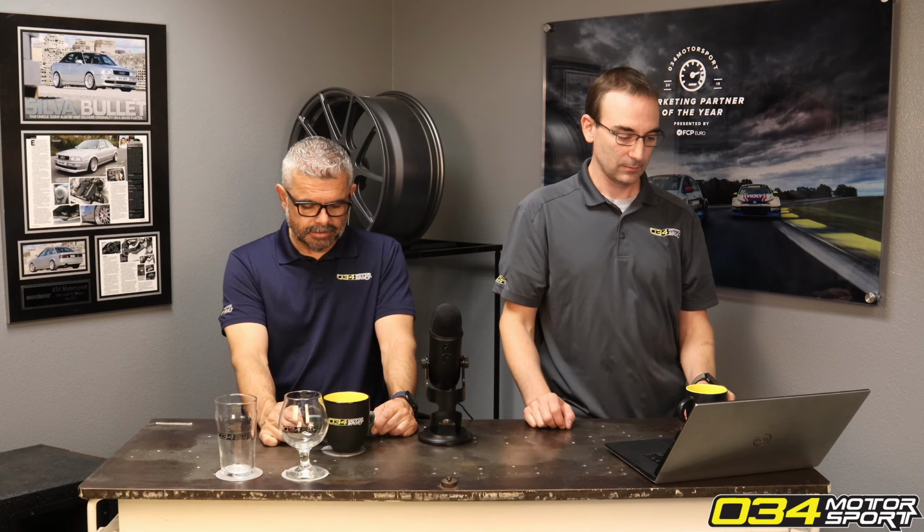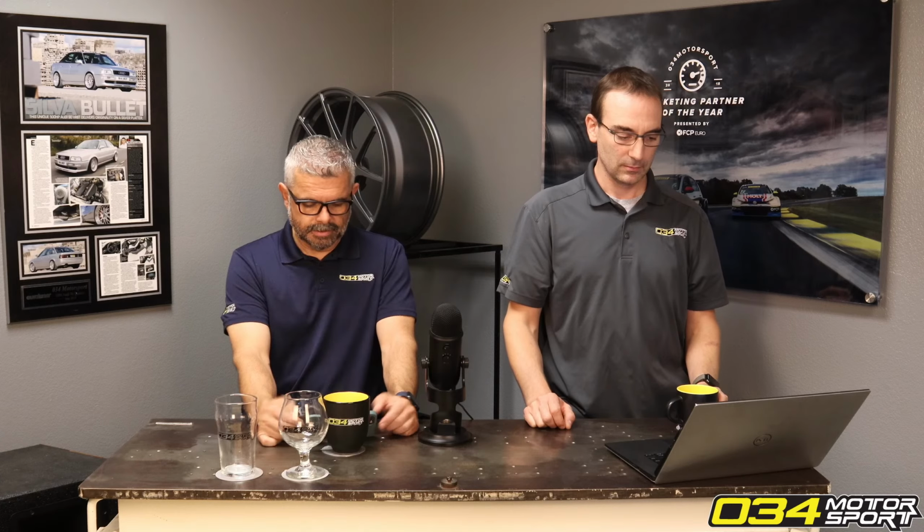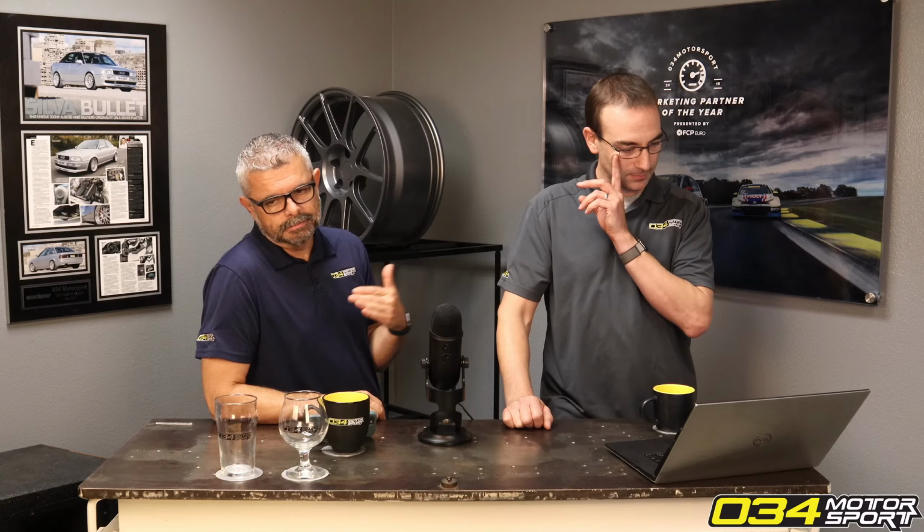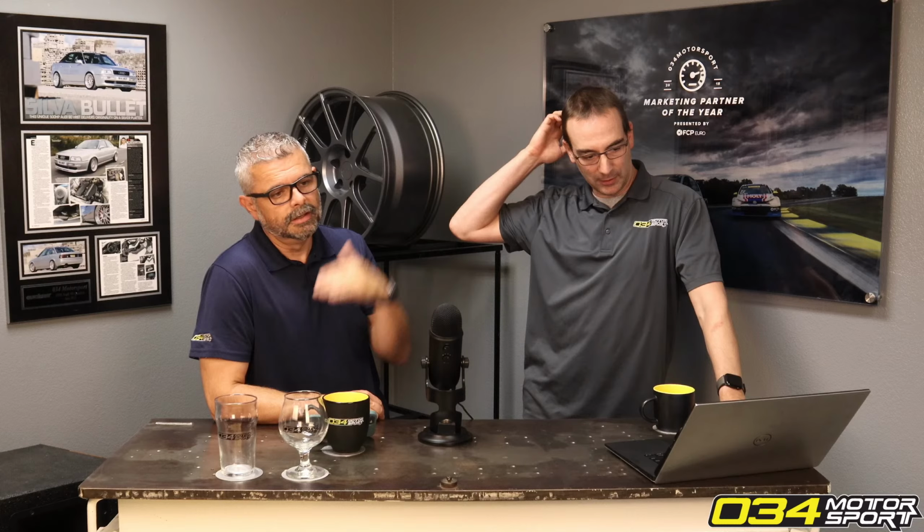Do the 3.0 TFSI tunes you sell take into account countries that are below sea level? I've heard some people have trouble with overboost. Yes, as much as we can, we use the barometric sensor for everything we're working on. I don't know how far below sea level you can get. Even Death Valley's not that far below sea level. Most places below sea level are below the sea. The effect of being below sea level is much less than the effect of being above sea level. You could be at 12,000 feet. We're talking hundreds of feet below.